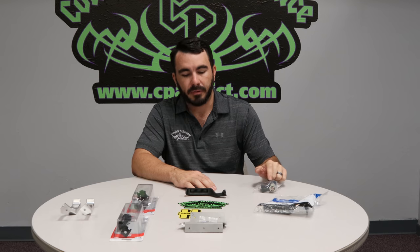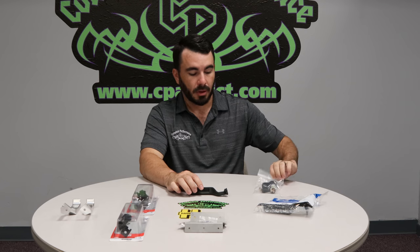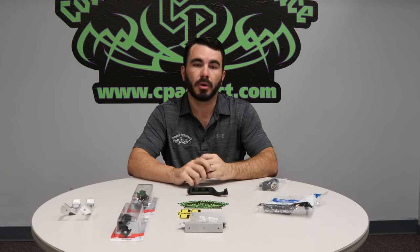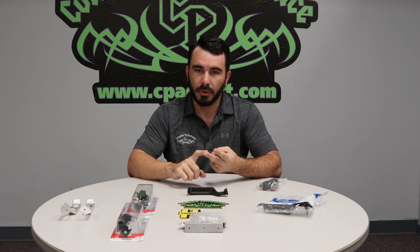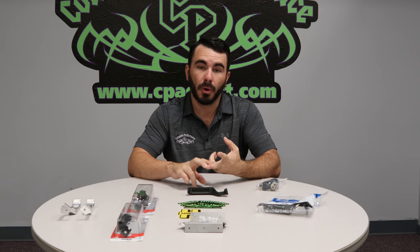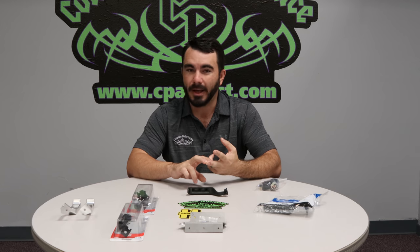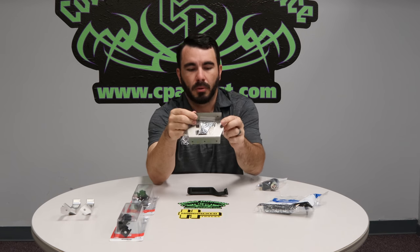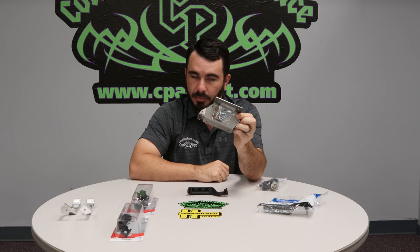If you open the door and the door drops, you have to yank on the handle harder to get the door latch to release. The very first thing everybody should check is door pins and strikers — we have a convenient kit that comes with everything together, one kit per door. The most overlooked issue is that Ford didn't put enough support material in the door handle assembly where it attaches to the door. Over time the door metal fatigues, and a lot of guys break the door handle completely out of the door and try to cobble it together with a big washer and bolt. We have a door handle reinforcement plate that works better than all of those methods.